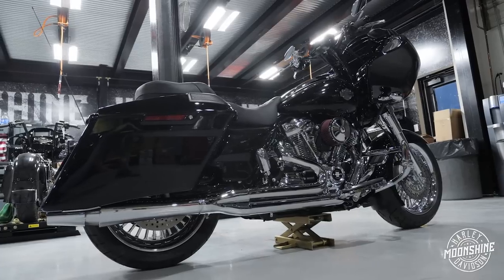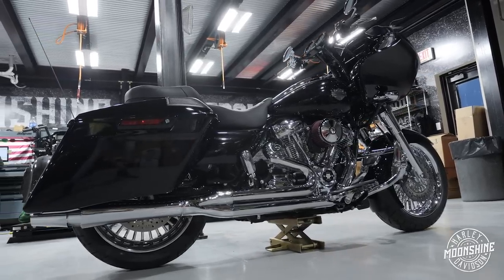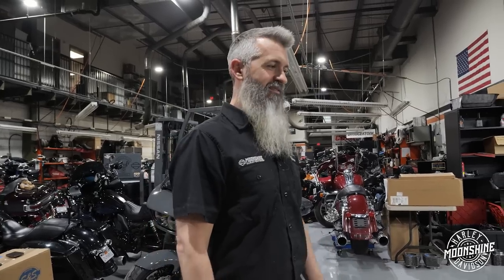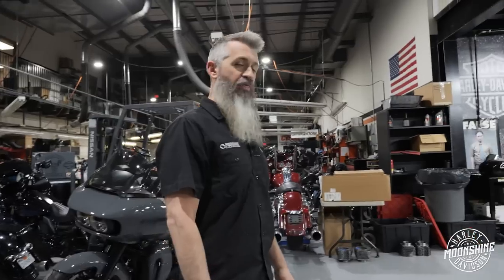You can't get around that huge chrome Thunder Header on this bike. It's one of the best sounding M8 exhaust systems on the market for a built high-performance motor or any built motor. If you're running a stock motor, it's a lot of exhaust for a stock motor. But the Thunder Header — if you're running our MHP 45 cam, perfect; if you're running something bigger, it's just an awesome sounding exhaust. It's not going to be the quietest, so make sure you want a little bark on it. We'll have a sound clip here at the end of the video — it's everyone's favorite part.